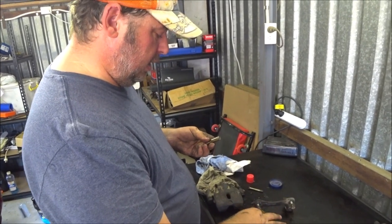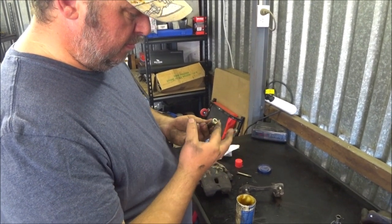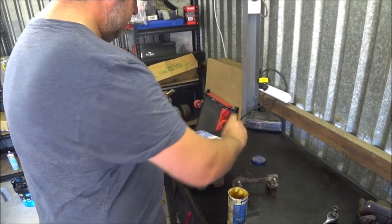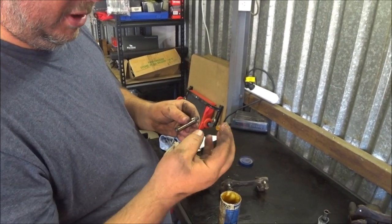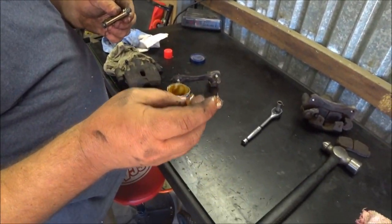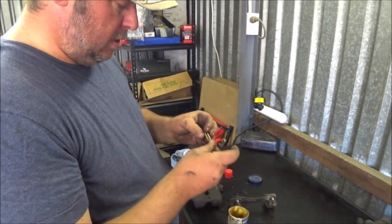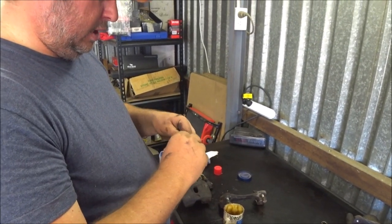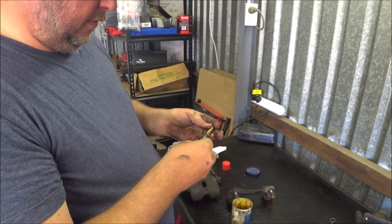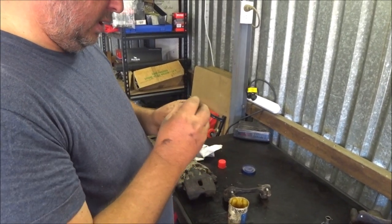So because this bolt here slides inside this sleeve, pre-pack this. Use the bolt. Ooh, look at that sludge. A bit of gunk came out. So that's a good way to get the last of it out. So throw that on that rag. Just make sure it's well lubricated internally. Both the bolt and the inside of the sleeve need to be well lubricated to allow the moving parts to move.